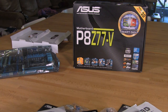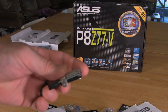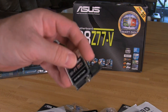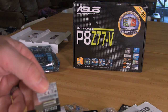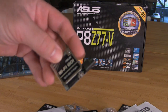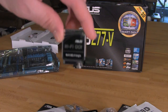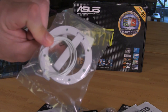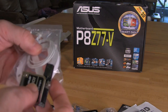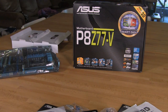The next thing is your Wi-Fi Go card — this is a small card, and that's literally all you get. It's very similar to what we showed you in the Maximus 4 or 5 Gene, where a card plugs directly into the board and draws its power. The difference here is you don't have the option to drop in an SSD. It connects via mini-PCIe, plugs directly into the board, and you push your antenna — one of ASUS's stand-up antennas with a little magnet — which you can tack onto the side of the case. That's your Wi-Fi card giving the P8Z77-V wireless connectivity.